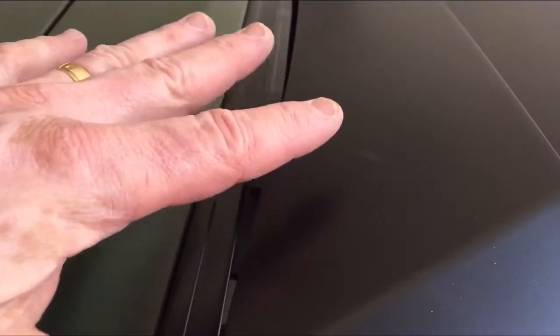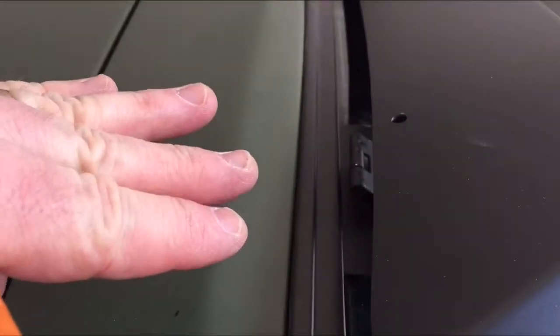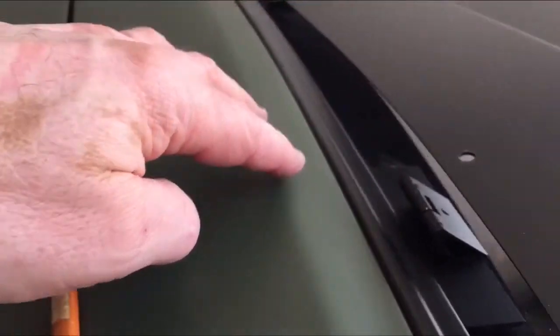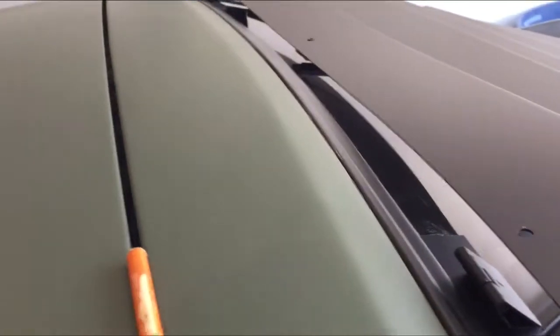I'll take the louver off, and I have some grease pencils here, and I'm going to take a grease pencil and mark around where the hinges are. And I'm going to get some alcohol out and clean the window down good, let that dry for a couple of minutes, take the tape off and actually put these top hinges on and let them dry for 24 hours. I tried putting the screws in this, but because the louver is so bowed, they just keep popping up on each odd side. So I'm going to start at the top, work my way down.